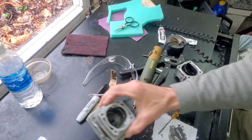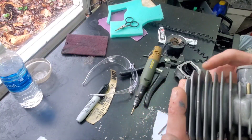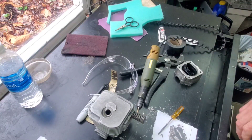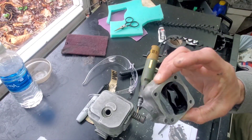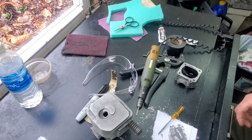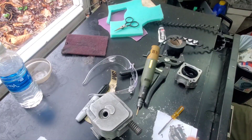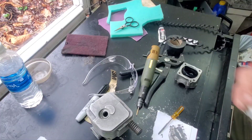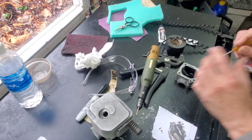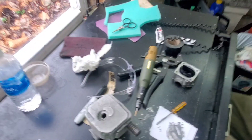Doing that just because I opened these up so much - I feel as though I gained air volume, so I'm trying with this to recompensate for what I opened up to keep the same compression in my crankcase. I believe that velocity counts for a lot of things.